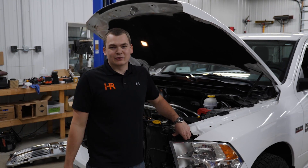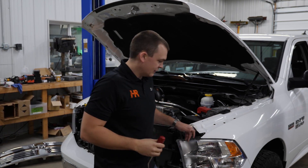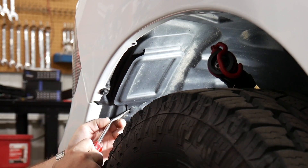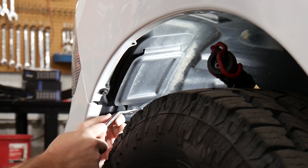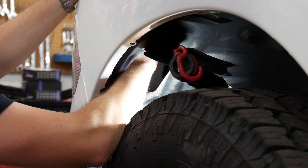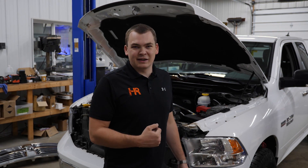We've almost got the headlight out of the truck now. We need to go down to the wheel well, pull a little access panel, and reach up — there's a little plastic tab that you need to push up to remove the headlight. Coming in from down here, take your pry tool and get under the center of this little push clip and remove it. At this point you can reach in, there's a white plastic tab, and just push up on it. It's hard to show on film but it is there and it's not too hard to find.